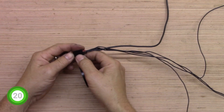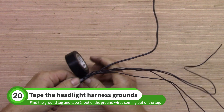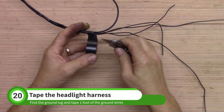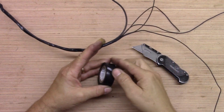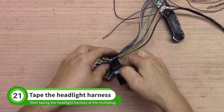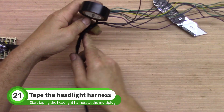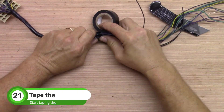Find the ground lug near the multi-plug. Tape up one foot of the ground wires. Start taping the headlight harness wires at the multi-plug, continuing to wrap up to where the ground wires meet the harness. Fold the taped ground wires back as shown and continue taping the harness for a few more inches.